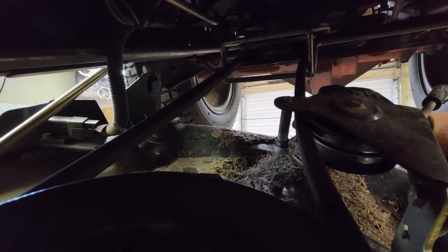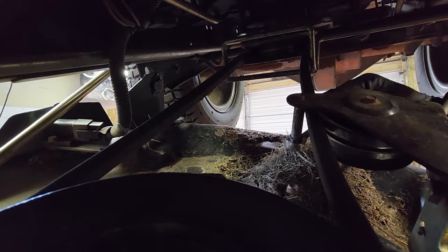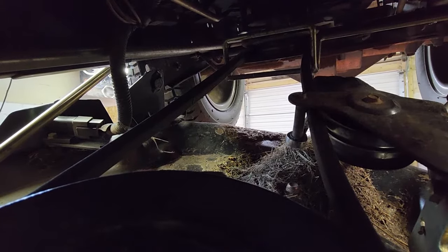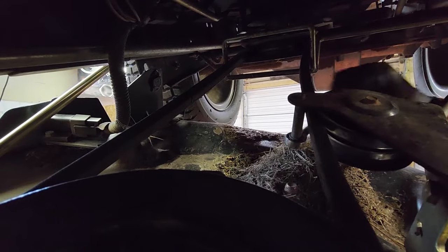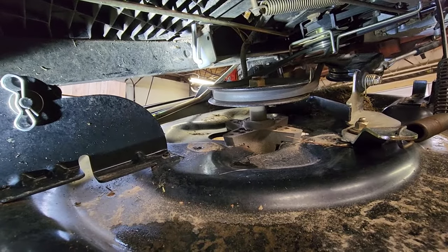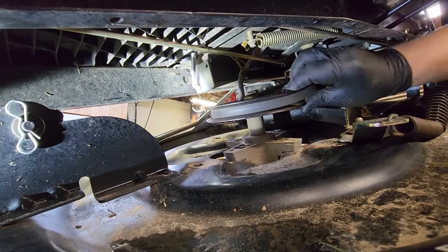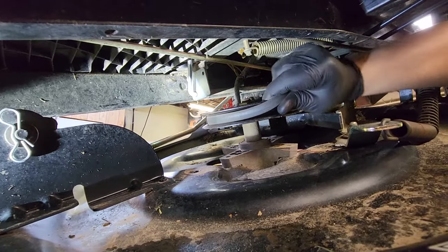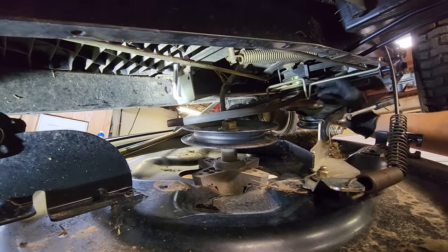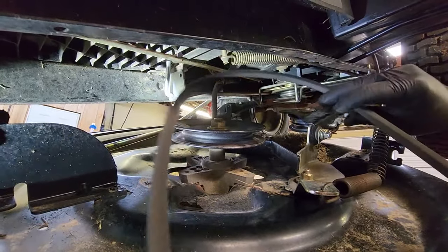Since it's a little tight right here, we're actually going to use a gear wrench, but any wrench will work. You can see it goes in from the bottom and we're just going to unscrew this thing and completely remove it. Now that we've got the hardware removed, we're going to pop off this belt — just raise up the deck with one hand a little bit and walk the belt off the middle spindle. Then back at the engine, just pull it off and push it forward. And that is the old belt removed.